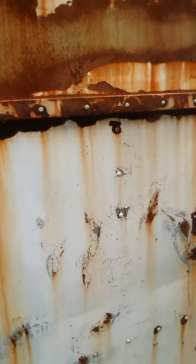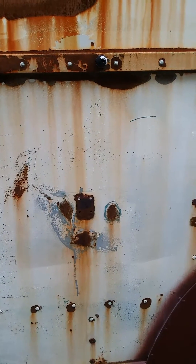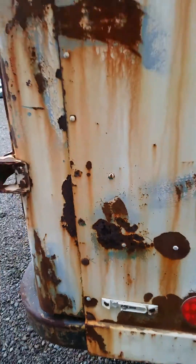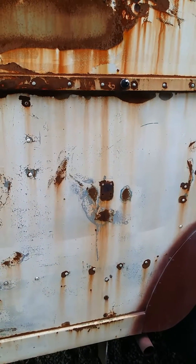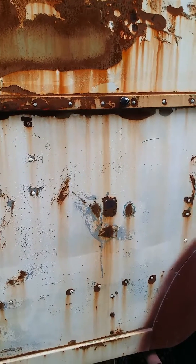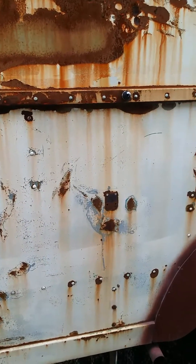What's next is I'll run down to Home Depot and find a 12 to 14-inch square gable vent or something to cut into the outside skin — that'll look fine. And while I'm cutting, I'll probably cut that piece of rust cancer out right there, it's pretty nasty. So I'll go find a vent, mark it all out, cut that hole, slip the vent in, get it riveted in. That's the task for today.